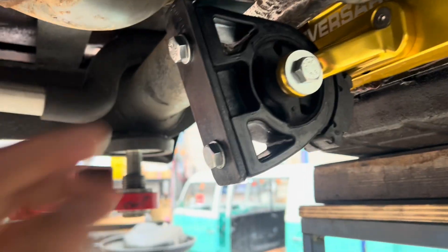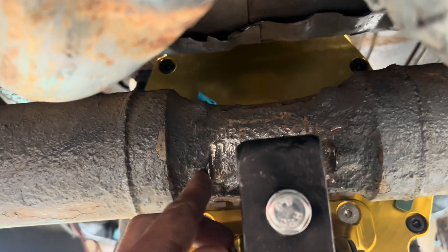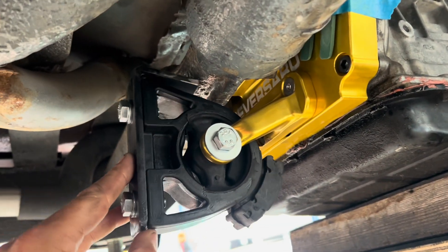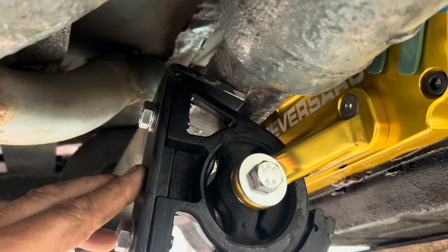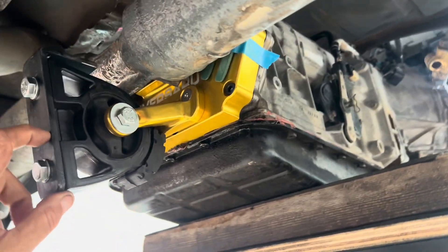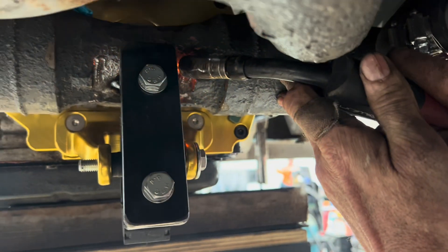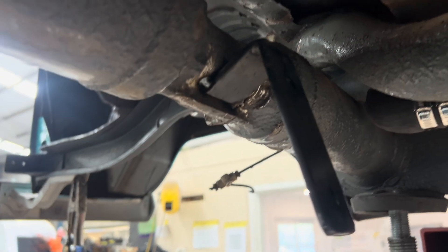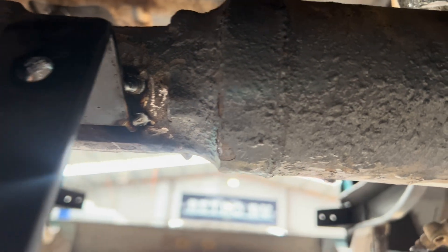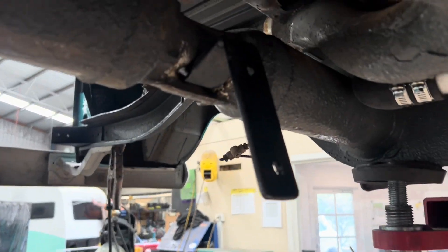With this bracket now we're up to welding this in. We've cleaned this up and will clean it a bit more. You find the centre by measuring between these two points, and then with the engine and transmission up, it sits there like that. Get some good angles so you can see where it sits. Then we'll tack this mount in place. So we've got the bracket now tacked in place with a few good tacks on this side so that we knew it wasn't going to move when we removed the transmission and the engine. And now we'll weld that right up.